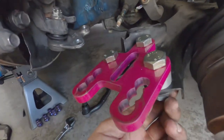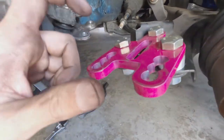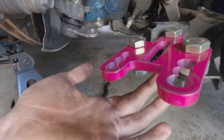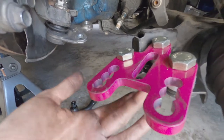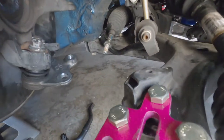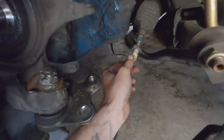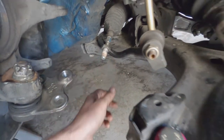I took the extension back off again and I'm going to put the spacers back in so I can move it to the second hole — the middle hole. That way I can get the nut on without any worries, because even with the extended tie rod I didn't have as much camber as I thought, so I couldn't use the last hole and still have safe tie rod thread engagement.